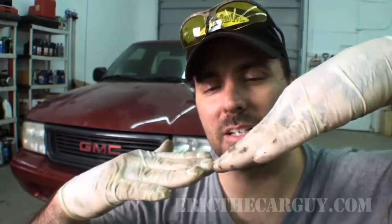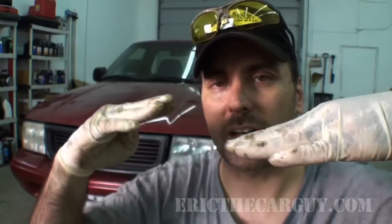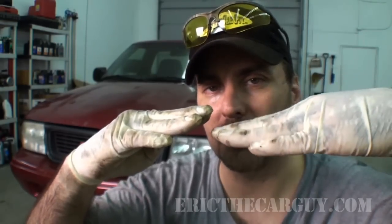If I were to do this again and it's a manual transmission, I would pull the engine and transmission all at the same time. And then I'd take the transmission off while it's out of the truck, do whatever I had to do to the engine, then mate the two back up while it's outside of the truck. It's very difficult. See, what you're doing is you've got this big heavy engine and you've got this transmission with this input shaft. And the input shaft is straight, it's not gonna move. And it's only a hole about that big.